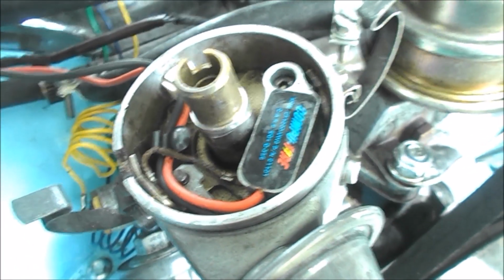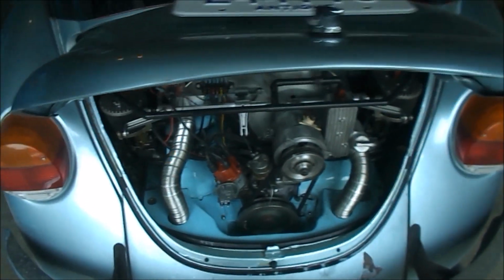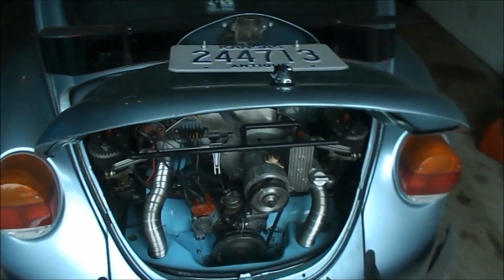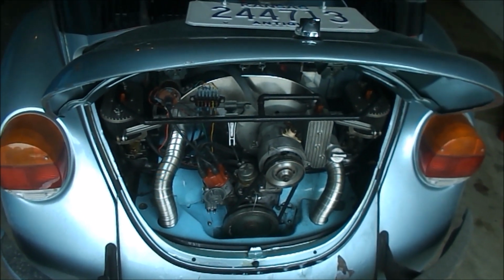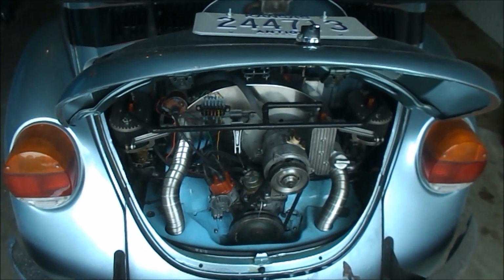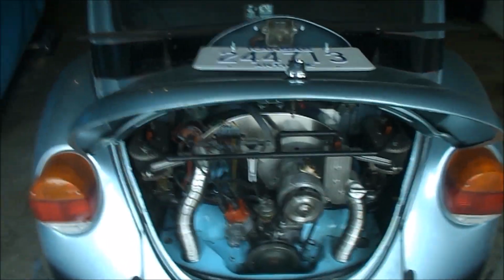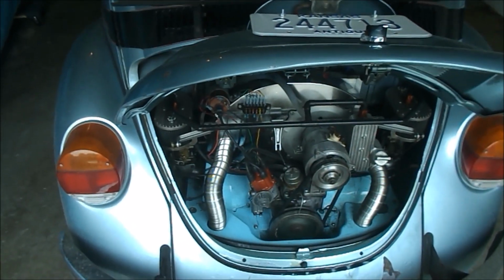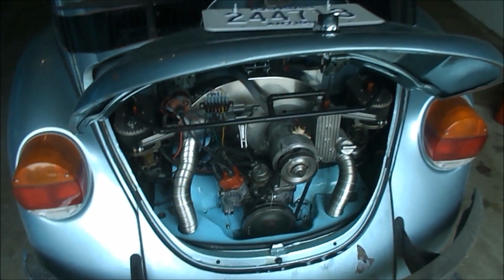Alright, that seems to be pretty good. Just back from a trip to the Taco Bell for a couple of burritos and some Dr Pepper for lunch. That's got it fixed. That's what it needed. I've got to see if I can get the vacuum canister working, or rather, see if it works. That'd be interesting. I haven't run a vacuum canister type distributor since it had its original motor in it. But I got to get the excess oil out of there. It's still got too much oil in it. I've never gotten around to pulling the extra oil out. And then I got to do a mileage run, now that I know it's not going to blow up on me. Should be able to do that this upcoming weekend, maybe Monday. We're supposed to have a break in the weather. It's pretty hot right now. Alright, more later.